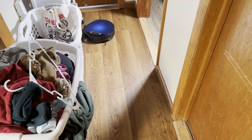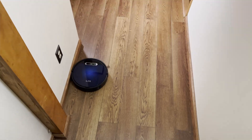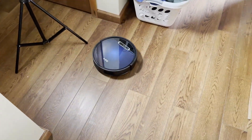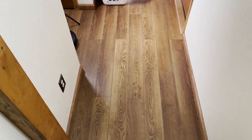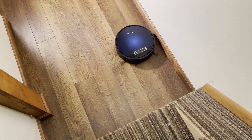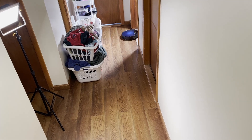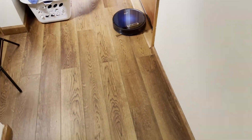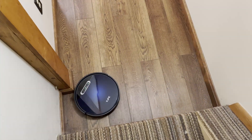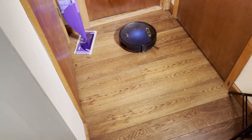What got me interested is really the bag. I was curious about robots without spinning brushes, but then I got the Narwal to test, so that wasn't it. That bag is a game changer — think of the bag in an auto-empty station; it's not very big but can last a month or more. What iLife did is take that concept and put it into the robot itself. The downside is as the bag gets full suction power decreases, but a robot doesn't need all that much suction power. I really like iLife because they constantly innovate. Should you buy it? If you don't want to spend more than $150 and you have a small apartment or limited space, absolutely — it's a great robot, and that bag means you rarely have to clean the dustbin.